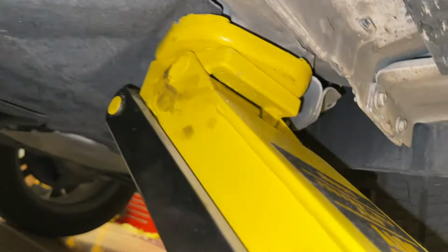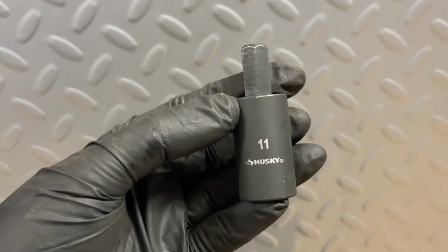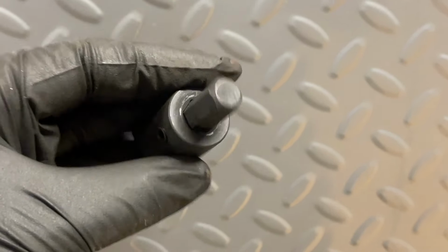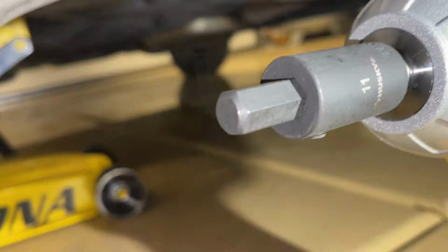So coming down on the bottom, we're going to do the same thing. Just get our screwdriver in here just to kind of pop this cap outward and remove it. And so the hardware for this is actually an 11mm Allen. So you might not have one of these. I'll put a link in the description where you can find them. And so that's how you'll be able to get these bolts off.